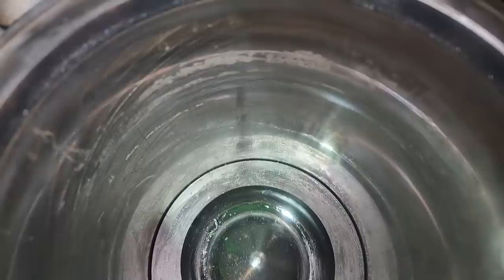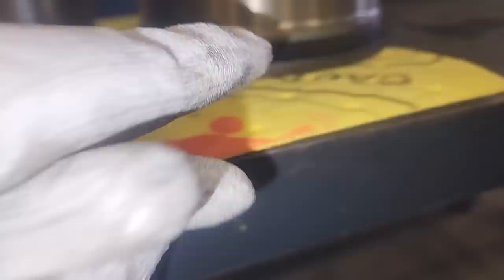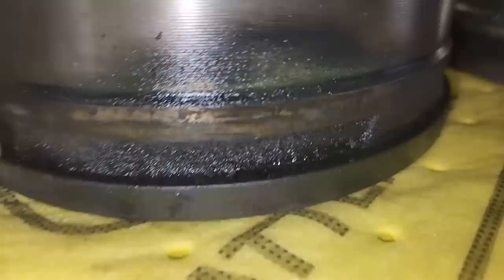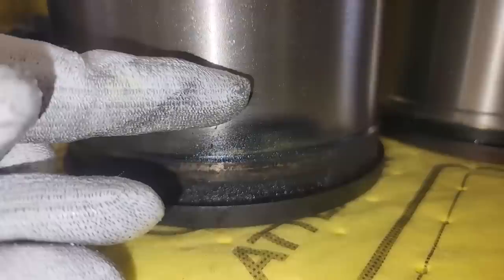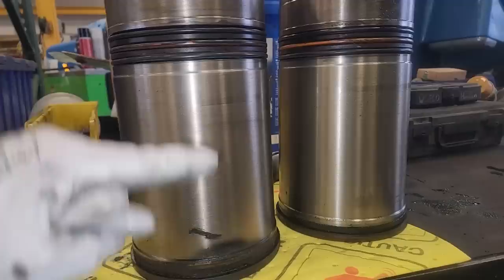We were able to get it out after some repeated attempts — it ended up taking about 20 minutes. Here's what I found — why it was sticking. You see the filler band on number 6? That's what it's supposed to look like. It is gone on number 5, and there's a heat marking right there. What probably happened is when the head gasket blew, it burned and left carbon deposits and burned out that filler band on top, which is what seals the cooling system from getting to the deck. Then coolant was getting into the cylinder that way. You can see the heat mark was on the other side also. All that carbon is what was sticking and making it stay in the block.